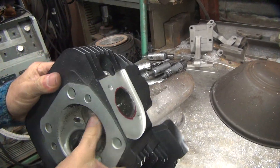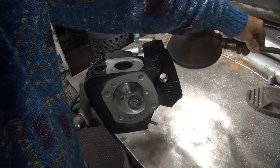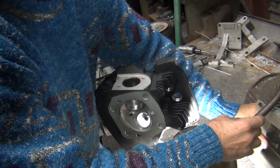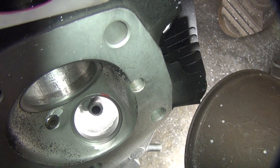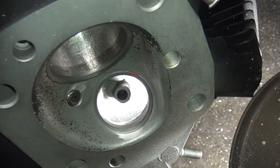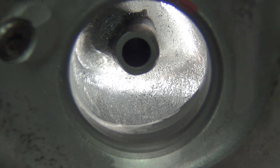So now you just work on the short side, which is an area you probably shouldn't be playing with very much because that's where you really kill the flow quickly. Oh boy. I like screwing around in the areas I'm not supposed to — I don't follow directions very well. So you can see right in there. See how the port looks from this angle? That's what the exhaust is. See how it has to go around that big ass hump there? So we're going to try to clean that up a little bit. You see it better on camera.